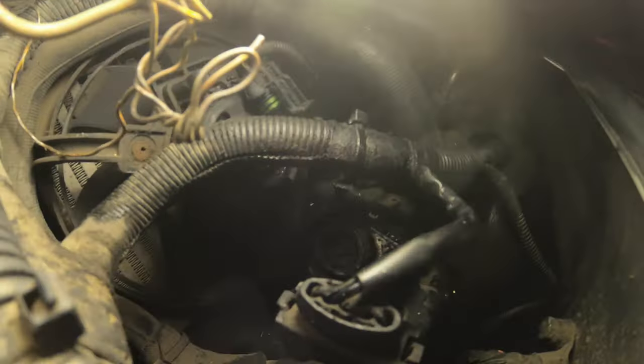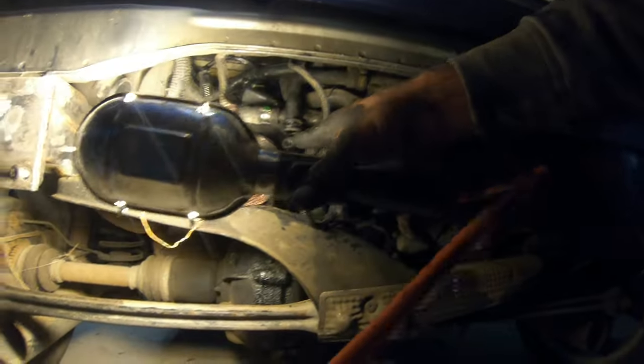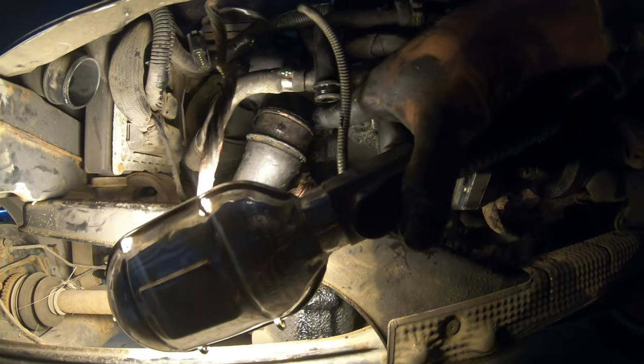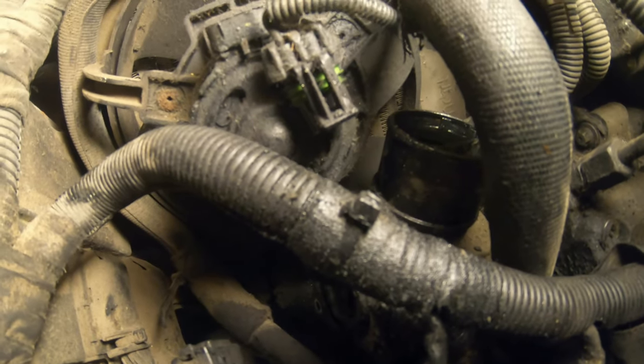There's one right here. There's one I pulled out already. It's on the bottom here. Wait, where is it? It's right there underneath the connection for the exhaust gas to go in under the EGR tube, exhaust gas cooling tube. So there's one bolt that holds EGR on there on the bottom, and then there's one right here that's below the motor on the intercooler there.